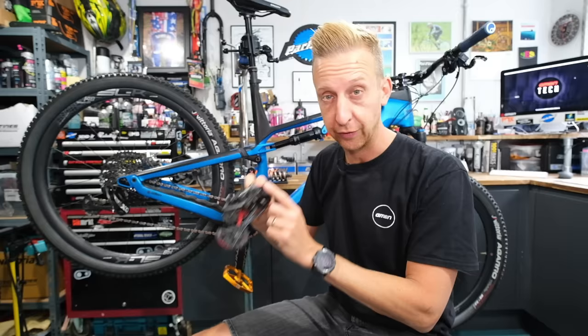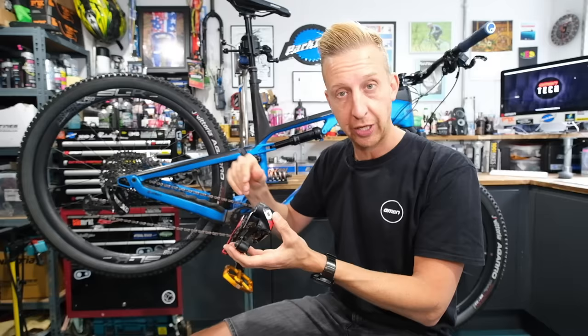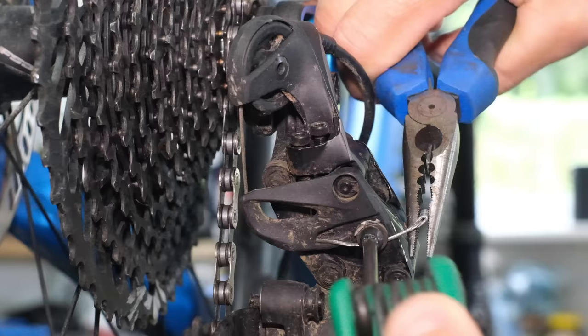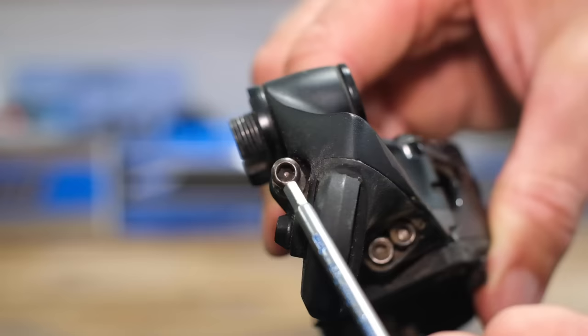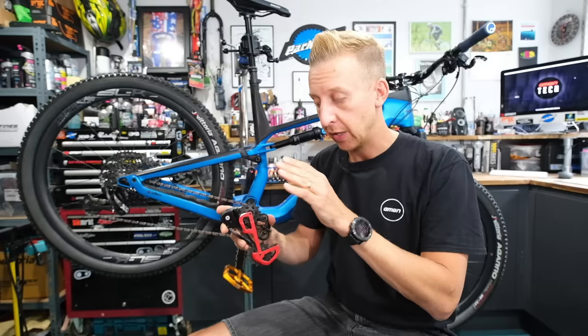As far as shifting goes, it has the same parallelogram-style design as you've seen on most derailleurs. This correlates to when you're doing the clicks with your shifter — it will move across and enable the chain to derail from sprocket to sprocket. There are three main adjustments and the cable clamp. The cable clamp clamps the cable you're operating at the shifter end. Two of the three adjustments are your limits for the smaller and larger sprockets, to make sure the derailleur limits its movement. The other one is the B-tension, also known as the B-screw, which controls the height of the guide wheels in relation to the cassette. You need this correctly adjusted for clean shifting.